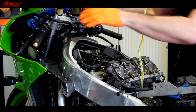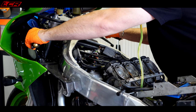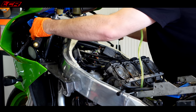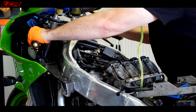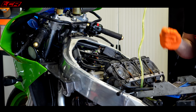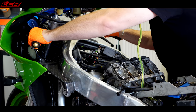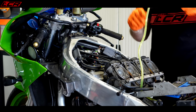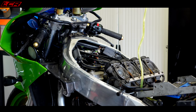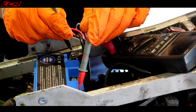It's trying to fire. It is so, so close to firing. Turn all this off because we've got a bit of a fire hazard here. Put that fag out, Mavis. There we go. 13.2 volts at the battery. Let's turn it on. We do have some voltage - we've got something happening on the feed to the fuel pump. It could be that the fuel pump is also gunked up like the carbs are gunked up with the old fuel. The actual fuel pump internals could be completely gunked.